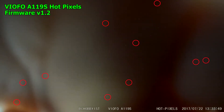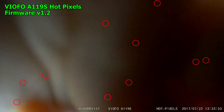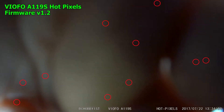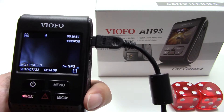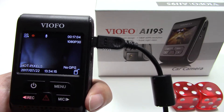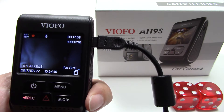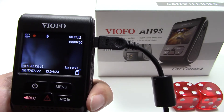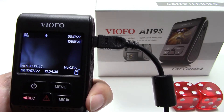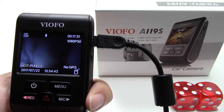This live clip demonstrates that these white dots only occur when the lighting condition is darker in that area. A hot pixel is described as an actual sensor pixel that is damaged or not receiving the correct signal. In this case the sensor is overheating, which creates more of these hot pixel white dots. If your dash cam seems to be getting more and more as the months go by, that can be overheating inside the dash cam.